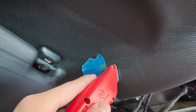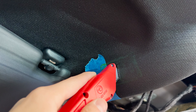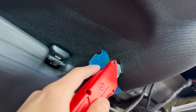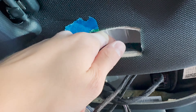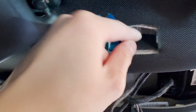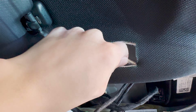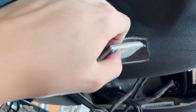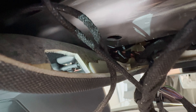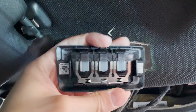I just did my first cut and honestly the material is very soft, so you can easily cut it with a box cutter — no need for a Dremel or anything. I cut it slightly undersize of what I measured so the fitment can be a bit tighter. If I need to cut more I'll cut more, because it's better to undercut than to overcut. Got the piece out — there you go. Now let's try to fit it on. Also, I did not touch the plastic, which is good — make sure you cut where you're not hitting the plastic.